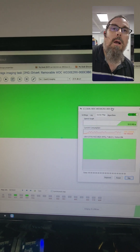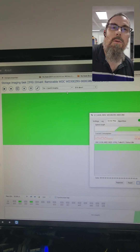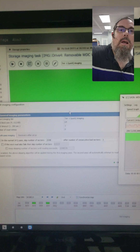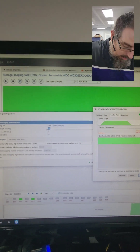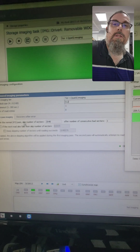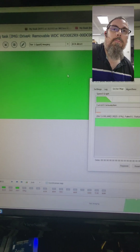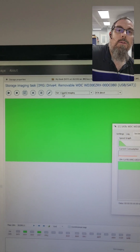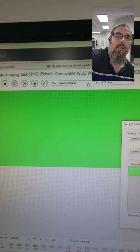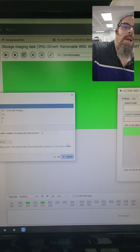Seems we're going pretty smooth here. Something we could do is if we want to, we can pause the imaging. I found that this has been relatively stable. You can change it from SATA to different connections, but you can also change the configuration — so if you want to go for a bigger block size for reading. You can change your configurations for imaging passes and click OK. Then just click Continue. That's the configuration for this task — the quick imaging. So if I wanted to change configuration of something else, I could go to Normal and then go back and make changes as well.